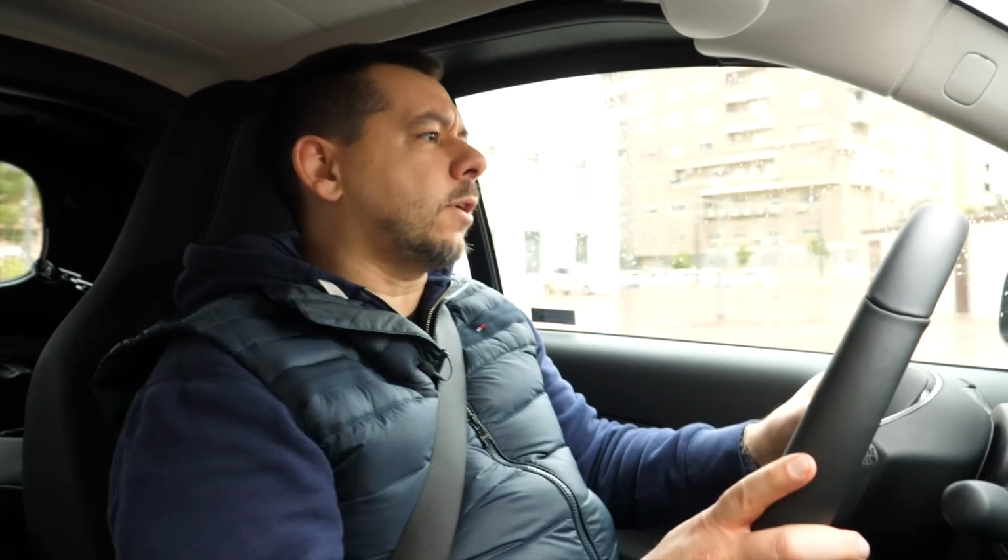And what about charging? The Smart's modest 17.6 kWh battery, that's less than half of what the current Nissan Leaf is packing, has a psychological upside to it. It takes only about 8 hours to charge from a regular 230 volt socket, and if you spend $1,000 on a 22 kilowatt charger, it takes about 40 minutes to get from 0 to 80% from a Type 2 socket.